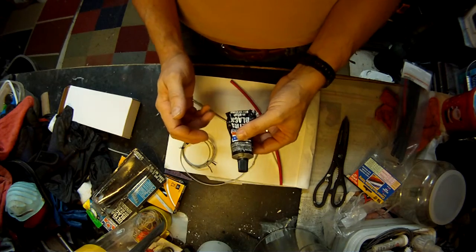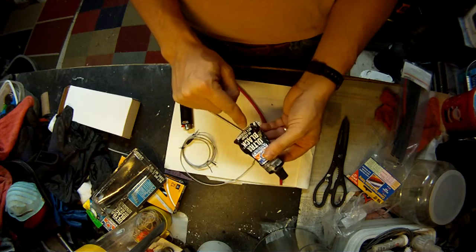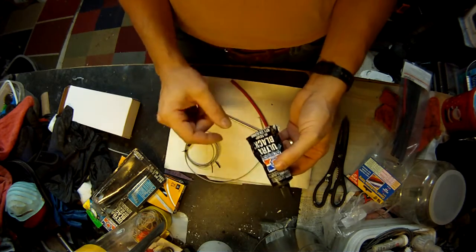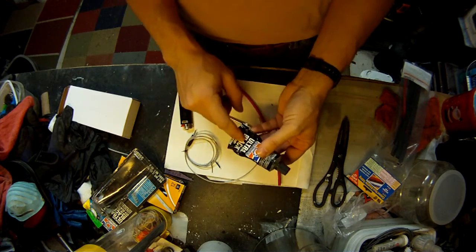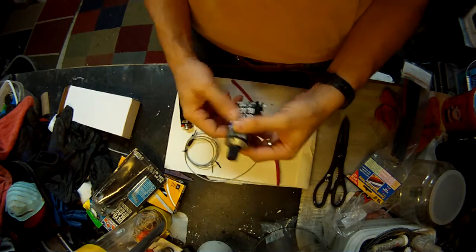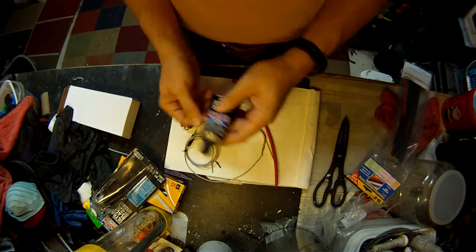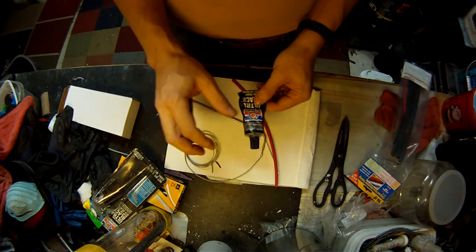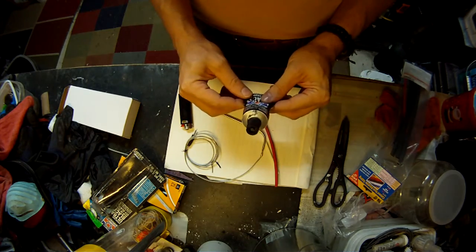Now if you're going to cook something really hot in the oven, you want to make sure that you use real silicone stuff here, especially the high temp. If you're going to be using this temperature controller while you're roasting, anything that gets into the 400, 500 degrees, you got to make sure you use the ultra black. But if you're just going to use it for boiling water, whatever, blue or any of the other temperature ones work great, as long as it's real silicone. It's not going to come in contact with your food at all. It's just a kind of special, extra way of sealing that guy up.